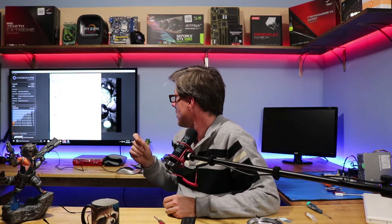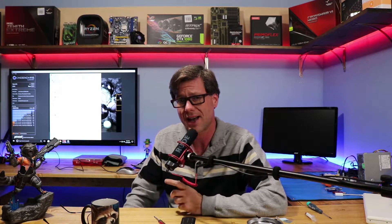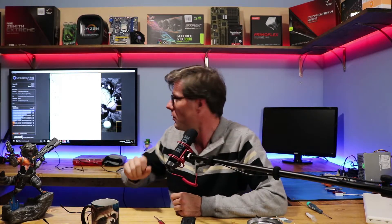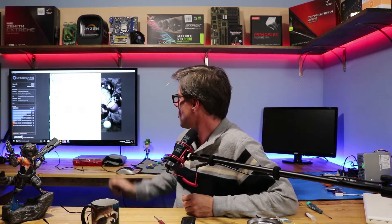Running the second test now that it's already warm — it's ramped up to full speed. Full speed on the fan seems to be at 83°C and thermal throttling is at 85. It has not hit thermal throttling yet. The hottest the core has hit under full speed on the second test right after the first one is 84°C. The current temperature went down a degree to 83°C and is still running at full speed. It finished at 103 on Cinebench — as good as the water cooling, and better than the first one.